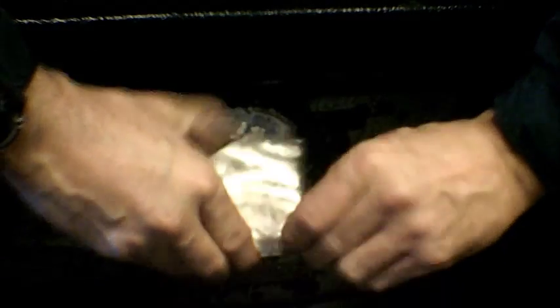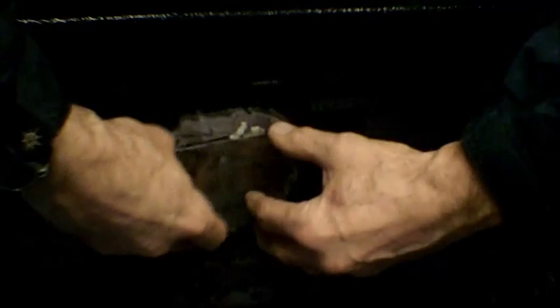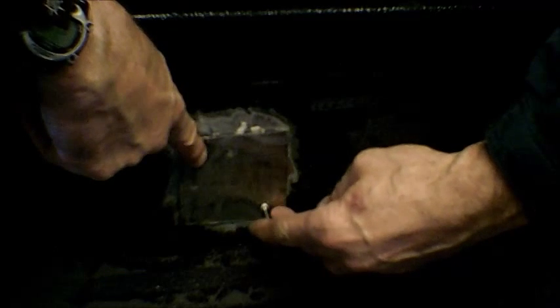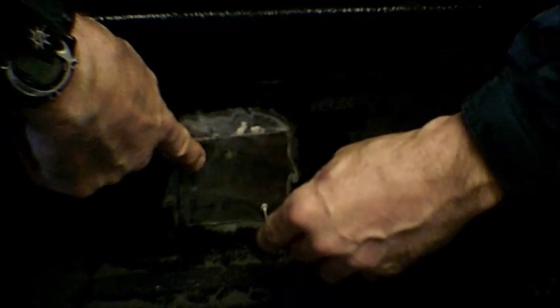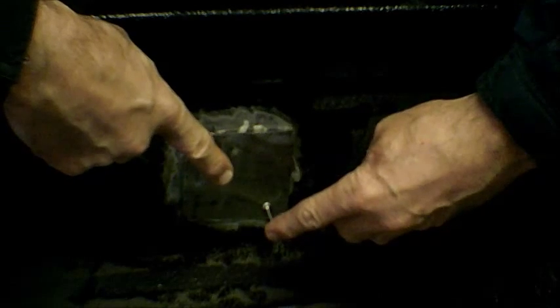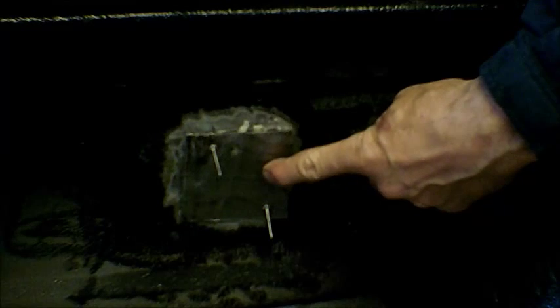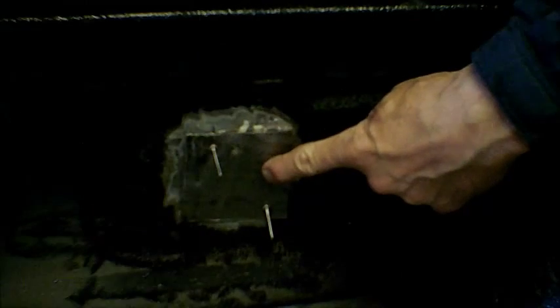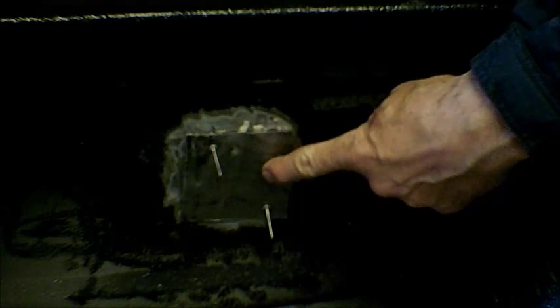Even though this backing piece is going to go in behind, I'm setting it up from the front. I've got one hole already riveted and I've marked where the other hole is. On the diagonal measurement we're two and three-quarter inches to this X, so that'll be my double check. It'll have a hole drilled in it and we should have another rivet in that exact spot, then we'll bring it up from behind the fender and rivet it in. The two-inch circle will go on top, giving us two layers of heavy gauge sheet steel to weld with the flux core welder.